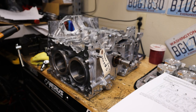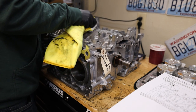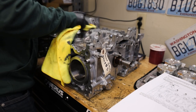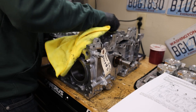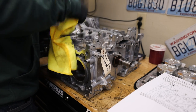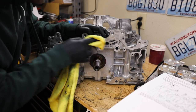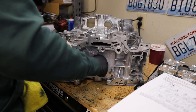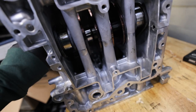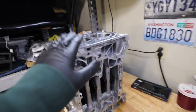The hard part's done; the rest is easy. I'm going to grab a rag and just wipe up the squeeze-out — I don't like to leave it on the engine. Don't use brake clean to do this because it can seep in between and eat the seal on the inside while it's still curing. Just wipe it up. Keep the timing chain area and the front fascia clean. Beautiful — the crankshaft spins beautifully and smoothly.